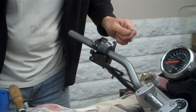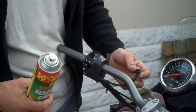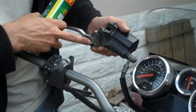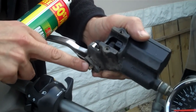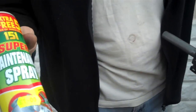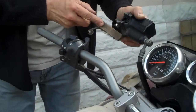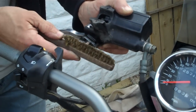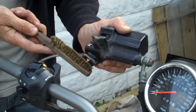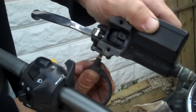While we're here, there's an electrical connector both sides — clutch and brake — which connects the switch. As you can see, it's quite common for these to get a bit scuzzy with corrosion because they're copper. So just spray this — maintenance spray or WD-40 Plus — then give it a little clean with a brass wire brush to clean those terminals up. This just ensures you get the best contact you can, and that just pops back in.